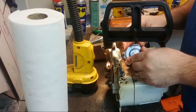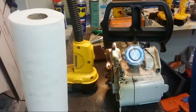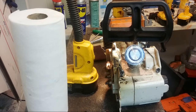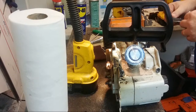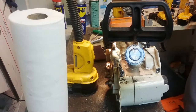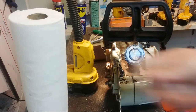Yeah, Mike, if you're still on, do you know if this is a 12 millimeter pin or a 13 millimeter pin? I'll just measure it. I think it's a 12 millimeter pin. So I need either 372 circlips or I need to use the aftermarket ones. I think I'll use the aftermarket ones, but I gotta grind off the ears. Don't like using the aftermarket clips.